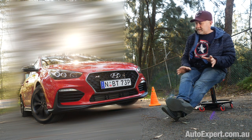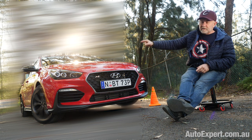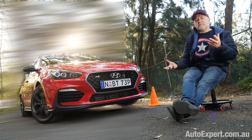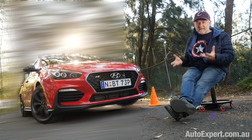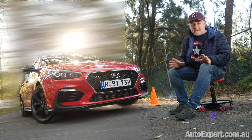And the big problem here is that this wheel is lighter at the moment than that wheel. There's less weight pushing down on this wheel. If you're hazy about weight, weight is actually a force, so it is affected by acceleration. Inertia has an effect on weight, whereas the mass stays the same, okay?